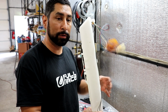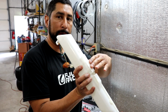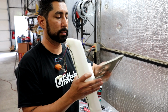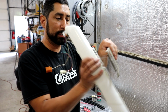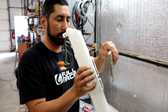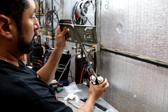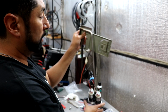So I pulled the sending unit out, then I was trying to reattach it on the tank, right? So obviously, sorry, let me try to set this up properly. Front of the tank, inside, and then the sending unit. I don't think it's that much curve, but this goes on, and then the pump bracket goes on. This slides in on the front of the tank. This has to go on prior to the pump bracket.